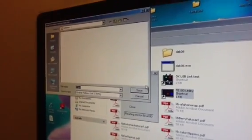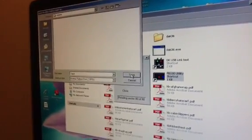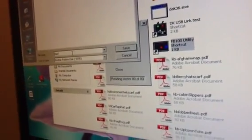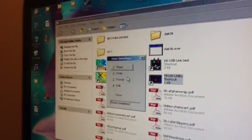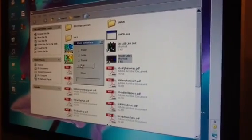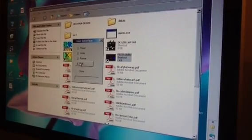It's read all 80 of 80 segments. Now it's asking you about saving. It saves the file as a BPD file. You click Save and change the name — in this instance I'll name it Clowns, so it becomes Clowns.BPD, and I'll save it in the Clowns folder. The first step in transferring is to read the disk by clicking Read. When it finishes reading all sectors, you save the file, change the name, and save it. Be sure to remember where you save it.